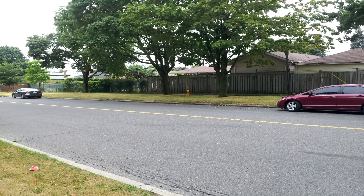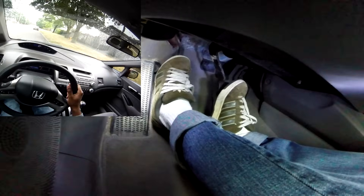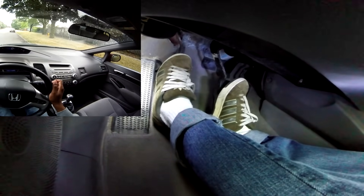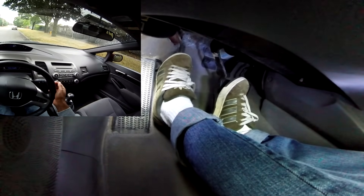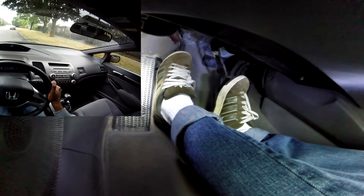What we're going to do is try to start the car before we get to that grey Honda Civic. We're going to roll the car, pick up a little bit of speed, then let out the clutch very slowly. The car should start. Once it starts, we're going to press our clutch in and brake.